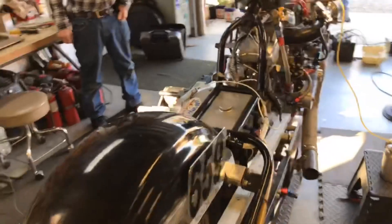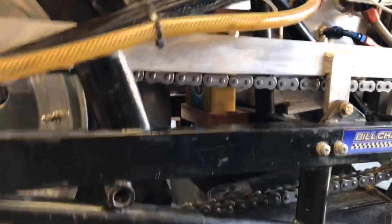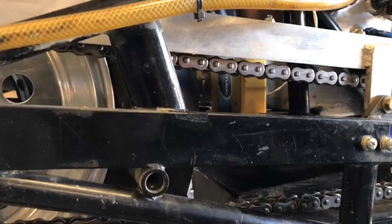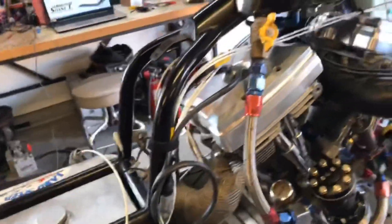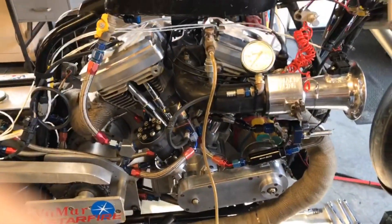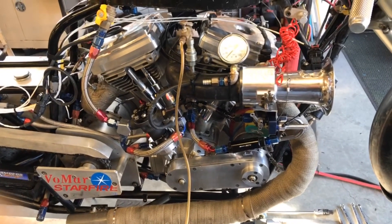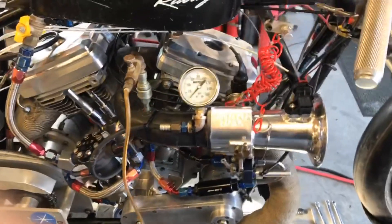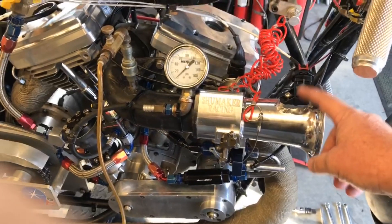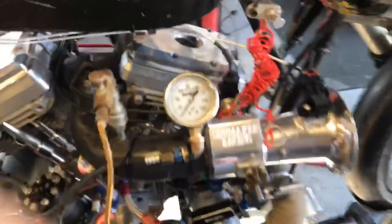So we've already been 196.343 with mechanical fuel injection, and we're switching over to a MoTeC M400 engine management system, which Kenny has cleverly hidden down here in front of the rear tire. We have this harness that we put together for it. We're trying to keep it very simple — a very simple setup with just two injector nozzles. The setup has a basic T-map here for barometric pressure and air temperature leading into the bell mouth, the throttle, and throttle position sensor on the back side.